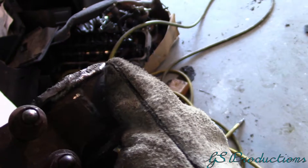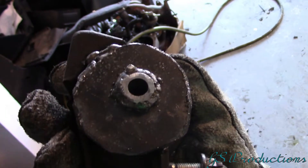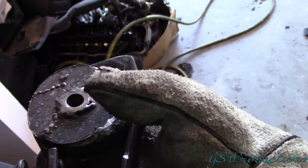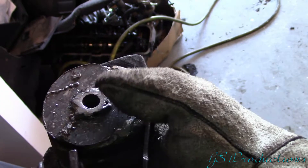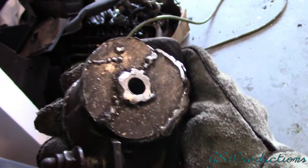I tried two different methods. One uses really thick metal — actually thicker than the engine mount itself — I just drilled a really big hole in it, pushed it on there and welded it. The other method uses two thinner plates of metal, cut in half, then a bench grinder to shape half a circle on each side, then push them together and weld it in the center.